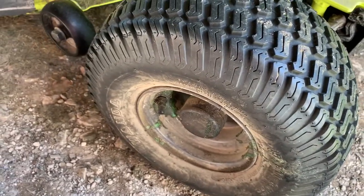It was messy and weird and I'm not really sure how it works. With ours, the puncture was actually on top, so I had to turn the tire the opposite way they recommended and do the slime again — only then did the puncture actually stop hissing and leaking air. It was a good-sized little hole. We took the rock out. It did its job. We did quite a few pumps, but I really wanted to make sure it wasn't going to leak, and it didn't. We have tires that are nicely inflated and haven't lost any air. You put the slime in, then right away put the air in, start using it, and it's done. It's the fastest solution I've seen.